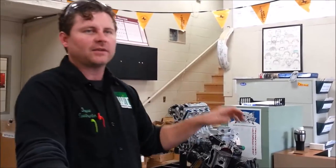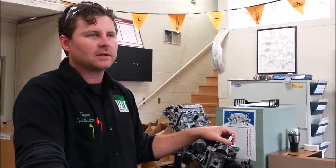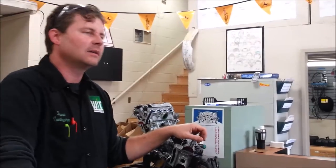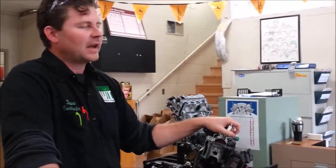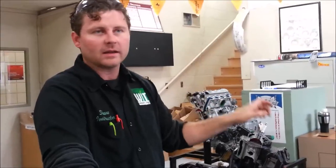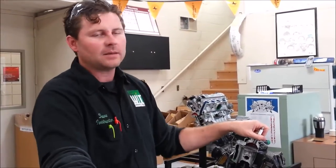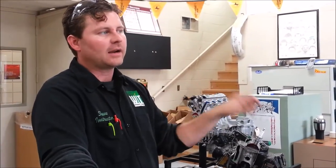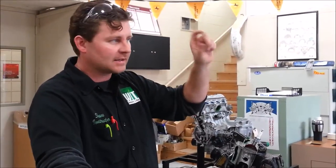We always have this misconception that putting the best fuel in is going to be better. How many people have ever heard of Cam 2 racing fuel? You find it at Sunoco dealers or at flat track and circle tracks — somebody there is always selling Cam 2 for stock car racing. Cam 2 can be anywhere from 100 to 110 octane, and everybody thinks they're going to gain a bunch of power. Almost every single bike you've ever put that in will lose power — it can't use it. It's not made for that high octane, not made for those compression ratios. That fuel is made for a V8 Chevy in a flat track racing motor that's going to turn high RPM with that ignition timing, head design, and everything else.